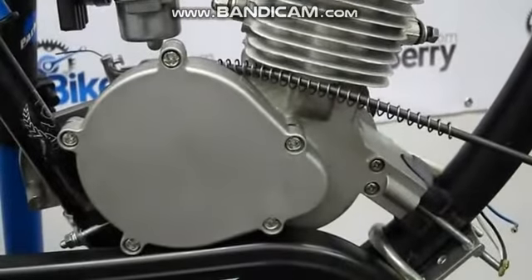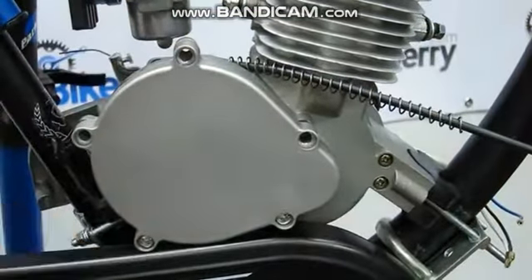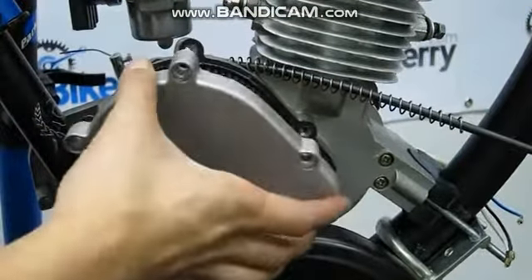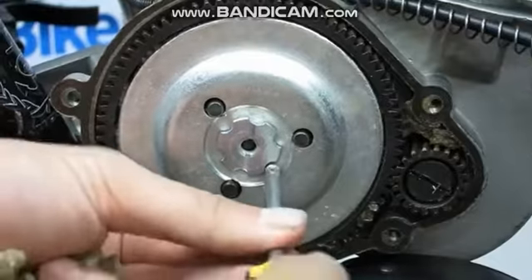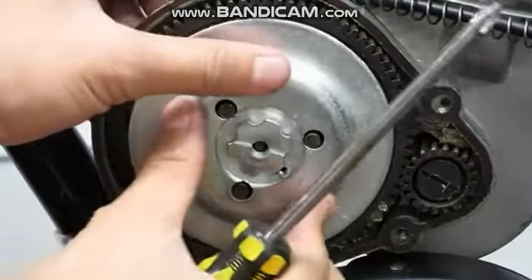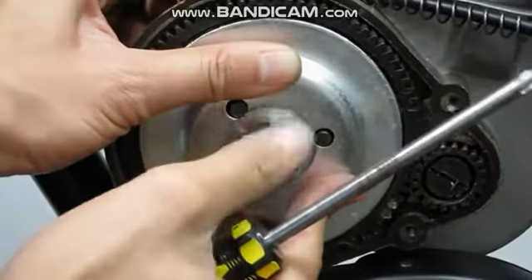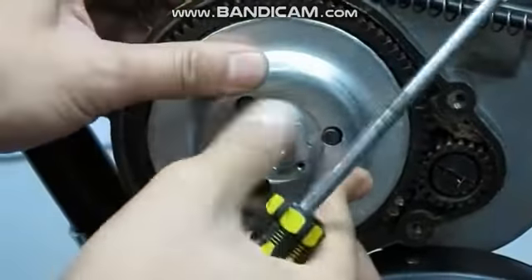One: on the opposite side of the clutch, remove the gear case cover. Then, unscrew the screw pin and unscrew the flower nut. One of the best ways to remove this is to simply press the clutch cover down, freeing up the flower nut. Once the flower nut is taken off, remove the clutch cover.